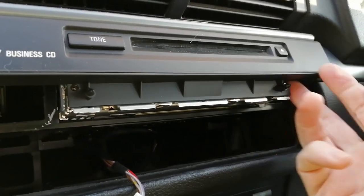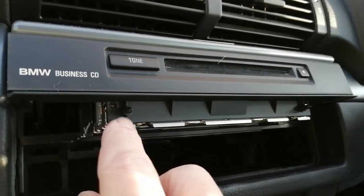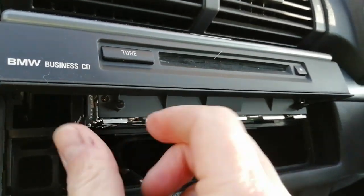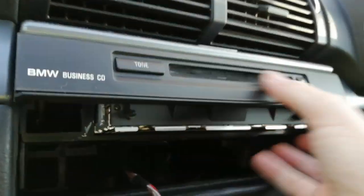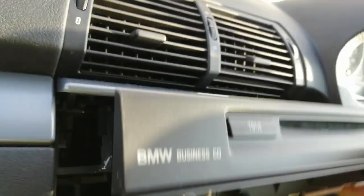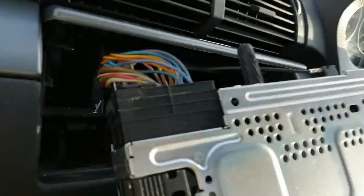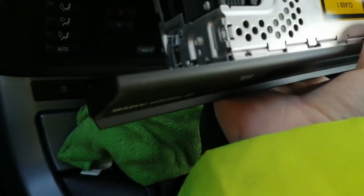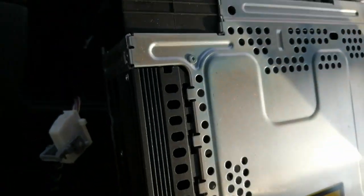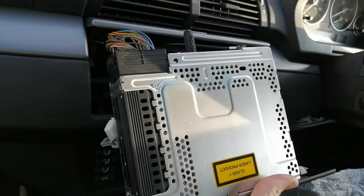You're going to need both hands — two fingers here, two fingers here. Make sure the bolts are fully withdrawn, as they do come out quite a long way. You'll think you've undone them all and you haven't. Then you just basically pull it forwards like so. You've got a quad lock and an aerial on the back to disconnect. I highly recommend you put a rag or something underneath it because the edge of this is steel — you don't want to damage your dashboard.